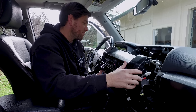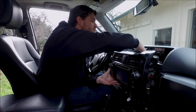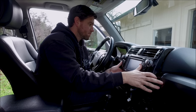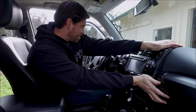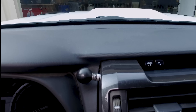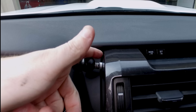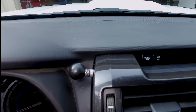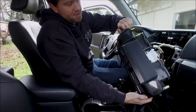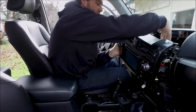Using a sharpie we put a really small dot down here — that's really hard to see — but we got that spot by putting the Ram Mount at about the angle we were looking for and pushing it nearly as far back as we could go. We didn't want it to hit the dash in any way. We figured out where it's hitting on the dash right down there where the silver part is and then marked that. So now when we pull this dash apart again we'll have the point at which we're going to drill a hole. We're going to do a quick little pilot drill hole first.